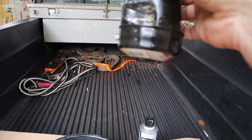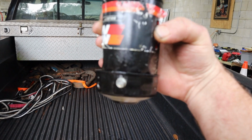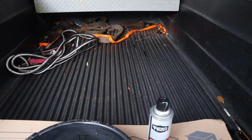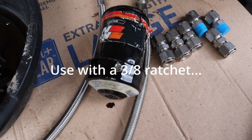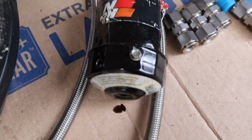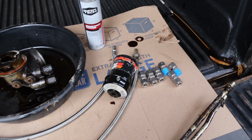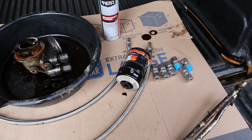And another thing, I got the oil filter off by using this stupid sheet metal socket thing that slips when you try to get it off if it's too tight. I'm sure it works fine if somebody don't over tighten it like I did. Drilled a couple of holes in it, self-tapping screw. I only used one self-tapping screw because I couldn't get in there with the other. It's probably a little out of focus, but you'll see what I'm talking about. You just drill a few holes in your little sheet metal socket adapter, and then try to get a self-tapping screw in it. Works like a champ. Like I said, I couldn't get a hammer and a screwdriver up in there with that tight fit.